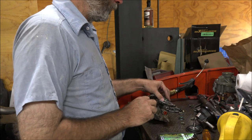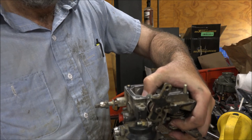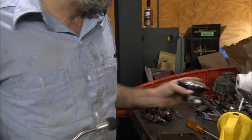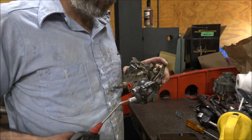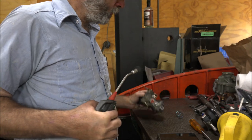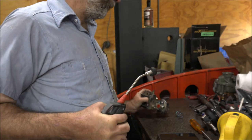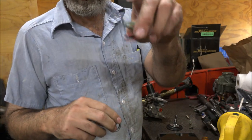Let's try the red spring and see if it makes any difference. Still bottoming out — we're at 20 pounds. Yeah, 20 will bottom that spring out. Now at 15 pounds, no, 15 won't bottom it. So if you have one, use the blue spring, not the red.